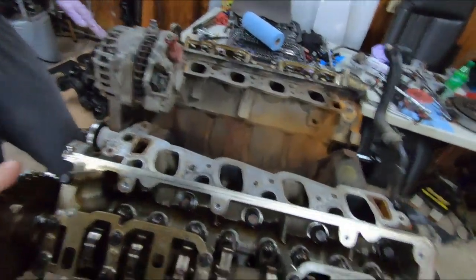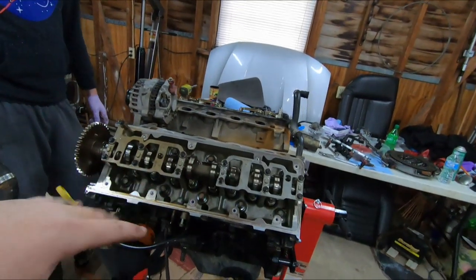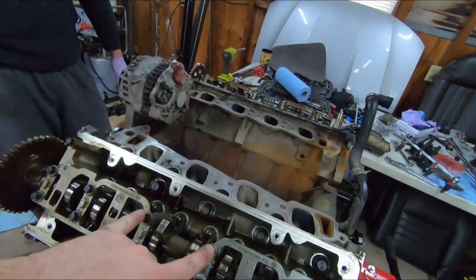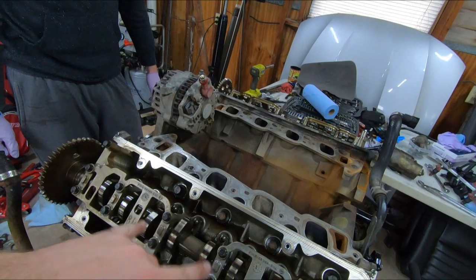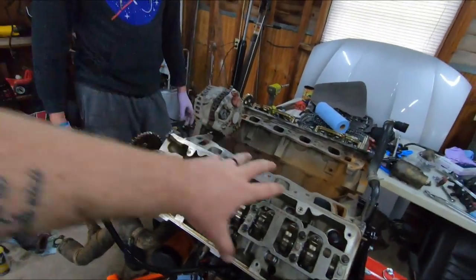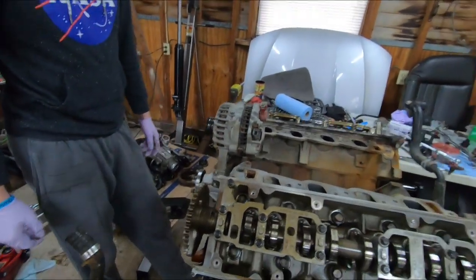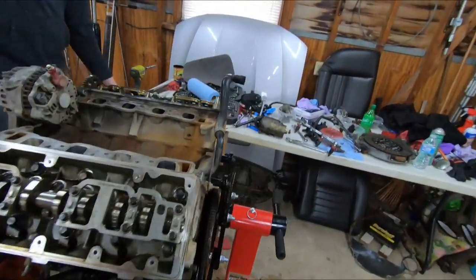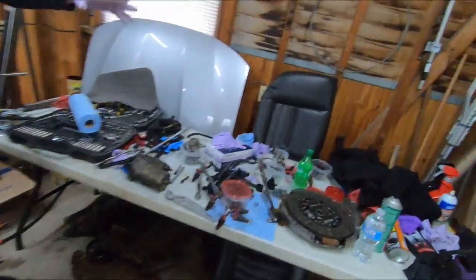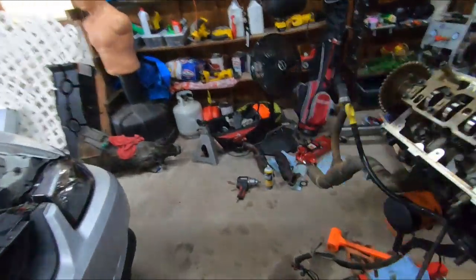Yeah, some work. We can pull the heads and leave the cams on, but I've seen where people break them loose and work their way out slowly, and then eventually it's loose, and you can just take the cradles off. So we do the cams. You're gonna have to anyways. And then, at that point, the lifters will come off. Let's clear a little room. We do need to have a clean spot for these. Get some trash bags.